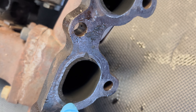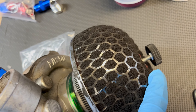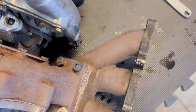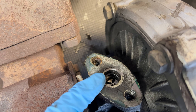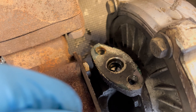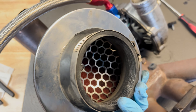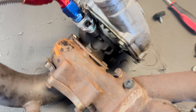Before I put it back on, I want to clean these ports from the exhaust manifold — they're a little dirty. The car wasn't on when I was taking off the filter. I think I must order the gasket for the feed line — it's not completely ripped but this is not good. There's a little piece ripping here, so I shouldn't be surprised if I see some oil leaking out from there. For now it should be okay. I'm gonna put the exhaust manifold parts in some warm soapy water with all-purpose degreaser and let them soak. The turbo itself has no shaft play — that's good.